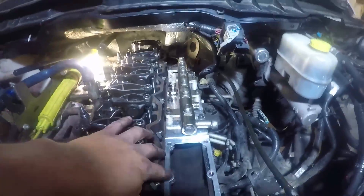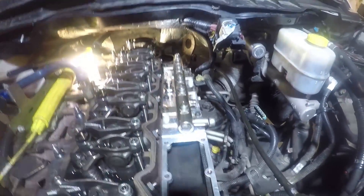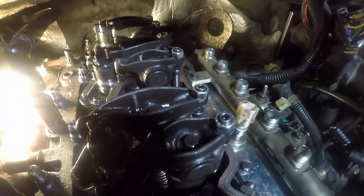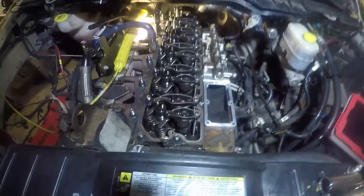All right guys, we got our rockers in and they're all adjusted — everything seems to check out. We got our fuel rail installed, though I didn't have time to connect the injectors. On our next video we'll install our injector lines, which is really not that hard. We also got the fitting for our dual CP3 dual feed rail installed. Everything's coming together — we'll have our valve cover on soon, then we'll get to doing the turbo, transmission, fuel system. We got a lot more to do, then we'll go racing. See you guys on the next one.